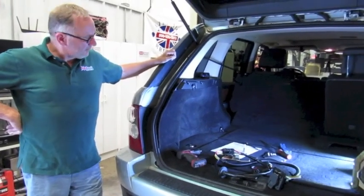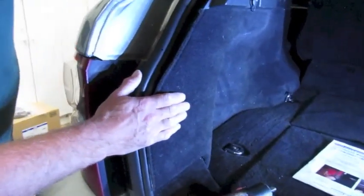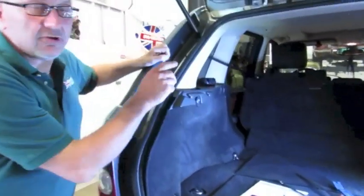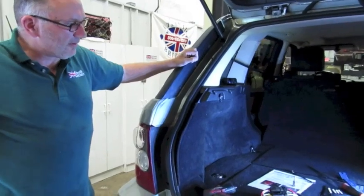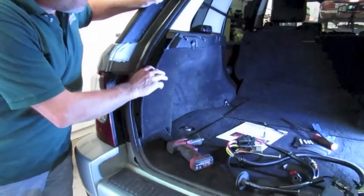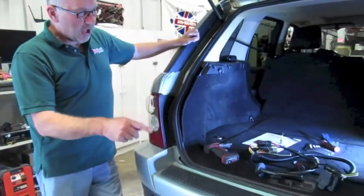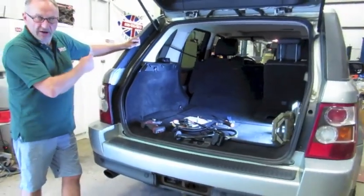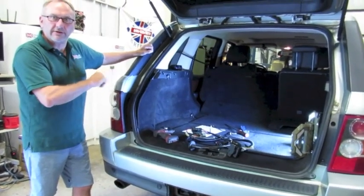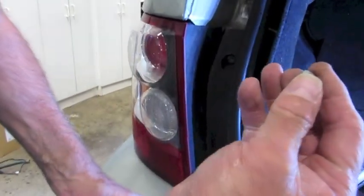To start off with, we're going to have to remove the rear lamp assembly, the interior panel, and flip down the left rear quarter seat back panel so we can gain access. Once removed, we're going to get access to all the right connectors on the inside of the panel. I'm going to run the harness through behind the bumper, up behind the tail lamp assembly, and then into the vehicle and connect up where necessary. Remove the rear lamp — two Phillips screws on the inside where the tailgate seal is, top and bottom.